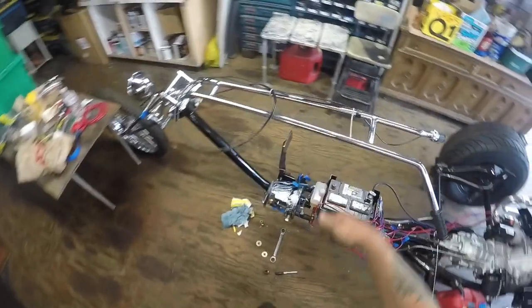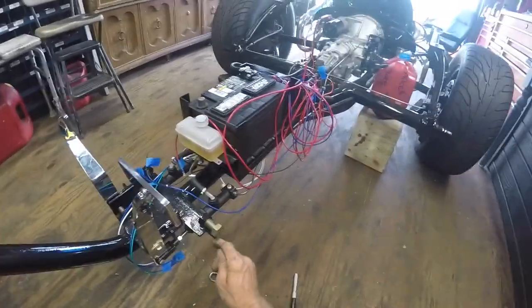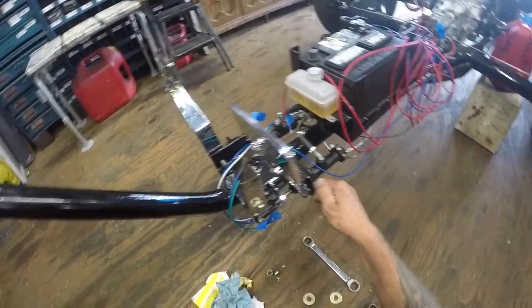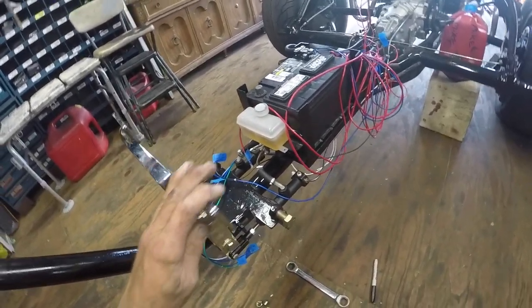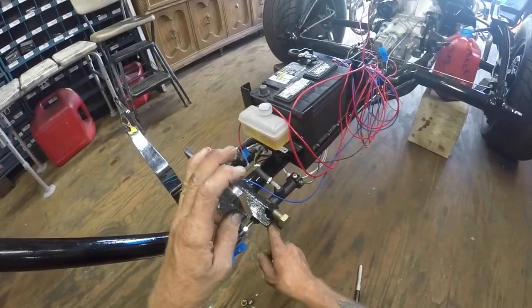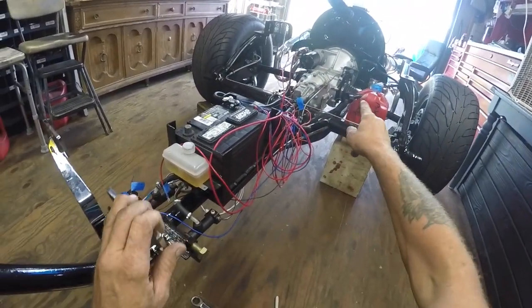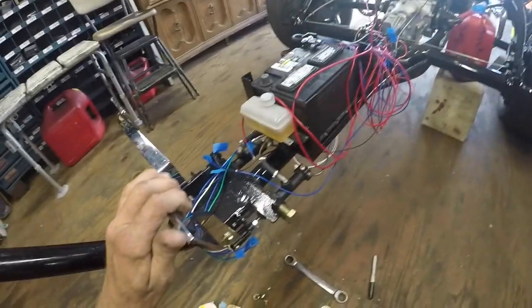One thing I don't like is that these are going to go through slots in the body, so you're going to have to remove this, which is going to attach the foot peg to it. I have to modify this - I'm going to make it a smaller bolt. I don't like that you can push this too far. It's got to have a stop to prevent the plunger from leaking inside, or pushing it too far past the o-ring inside the slave and making that leak.